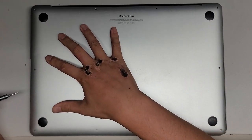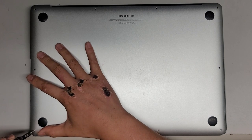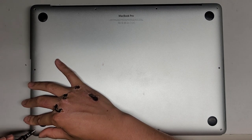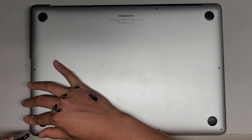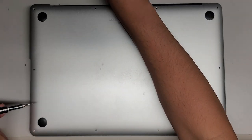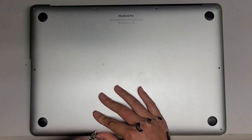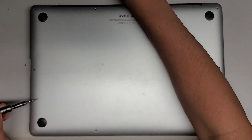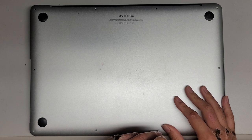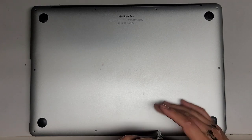As you can see, the battery is actually inflated here, so it's pushing the cover up. You want to be careful — hold the cover down when you're undoing the screws so that if the cover does fly out, it doesn't launch your screws somewhere else. I'm just holding this down, and as you can see the cover is popping itself up. Let's continue removing the last two screws.